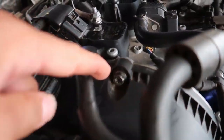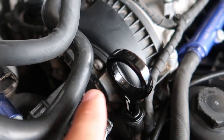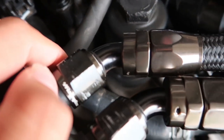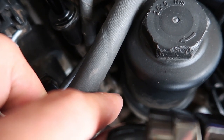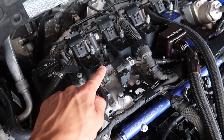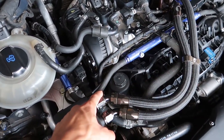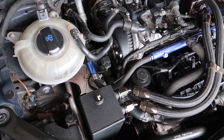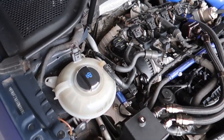I actually have a full video on this from a long time ago done on an iPhone, so I'm going to go over it again. It's not that hard of a job — you have about eight screws going around holding the cover in, three T30s on each cam sensor, and it just pulls right out. There's also a small screw holding the dipstick that you'll need to remove because it's down beside the bolt and the dipstick will be in the way. I'm going to disconnect this hose, pull the catch can out of the way, and go from there. Most of the fasteners are T30.